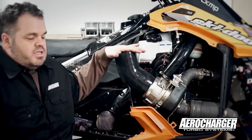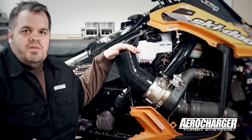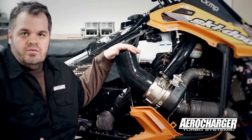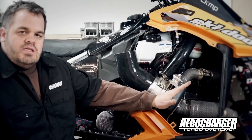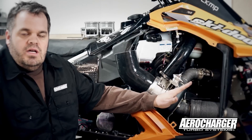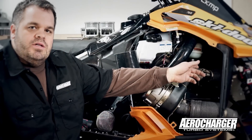If you put vacuum on the intake of a turbo, the turbo will still make the boost that you've asked it to make — that's the beauty of a turbine over something like a supercharger. But what happens is the turbine has to work harder, and in order to work harder and produce more energy it has to create more back pressure in the exhaust.